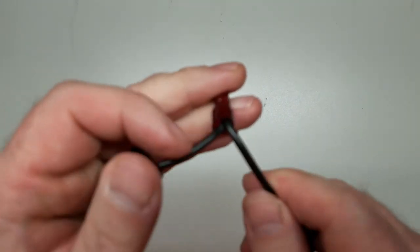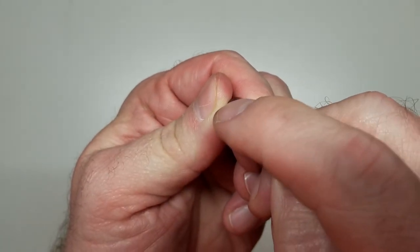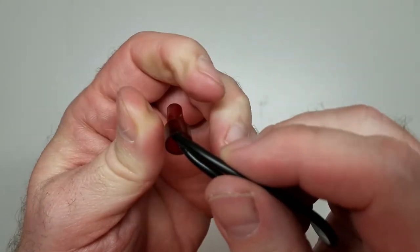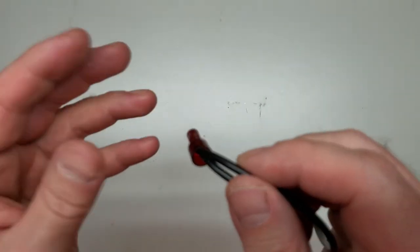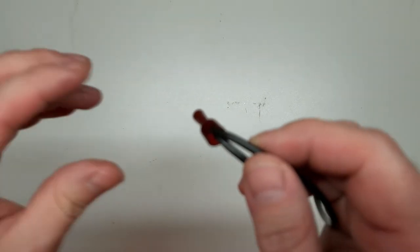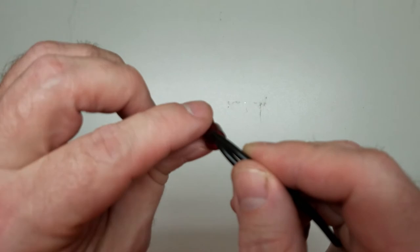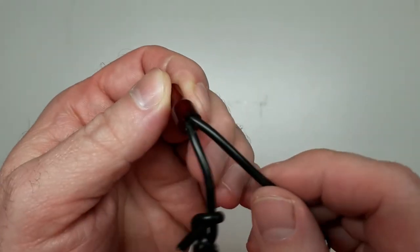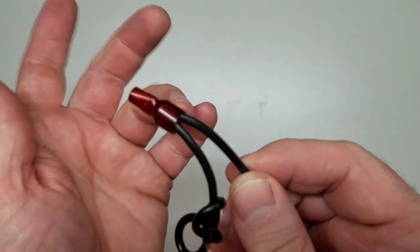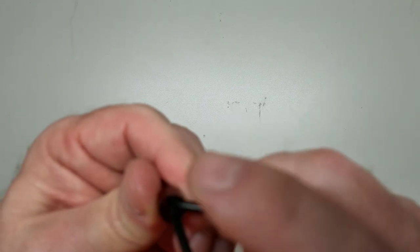Again, the downside, just like a butt connector, is that your wire strands down inside there are exposed. So if this is used outside, under the engine compartment, under the chassis, or somewhere like a back bumper for a trailer hitch connection, if you get any kind of water or debris up inside there, it's going to start corrosion of the wires, and eventually it'll start degrading your connection. If this is under your dash or something like that, not a big deal. But anywhere in the engine compartment or under your vehicle, this is a no-no.